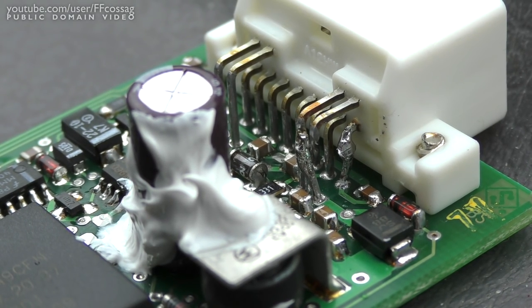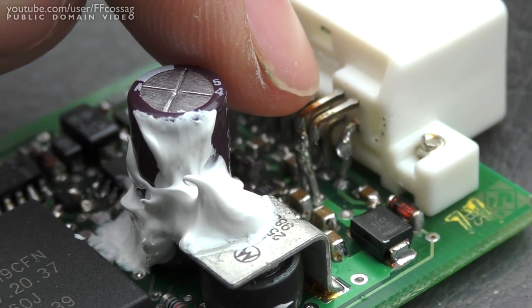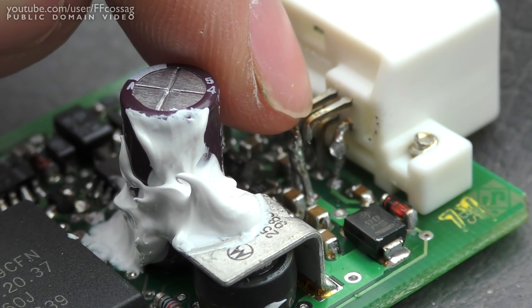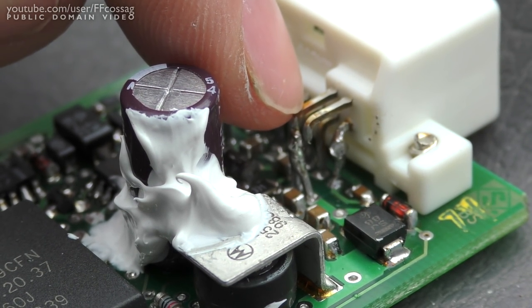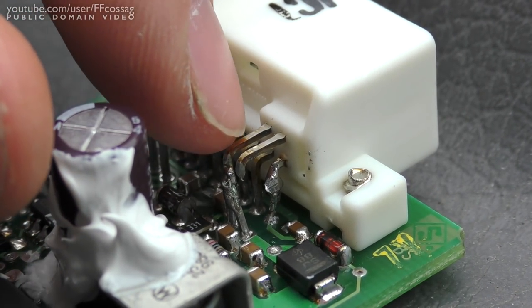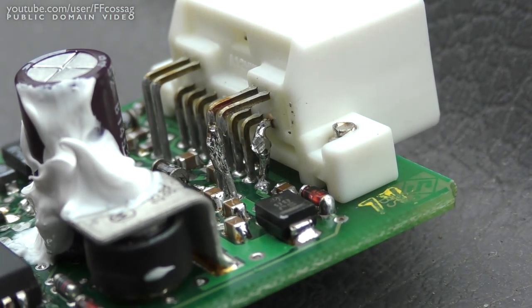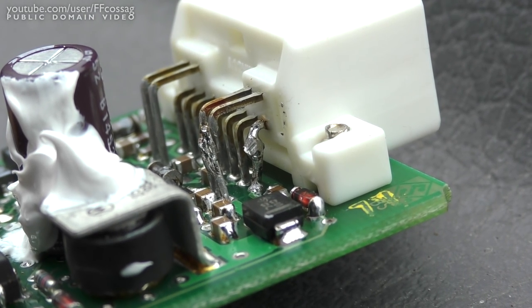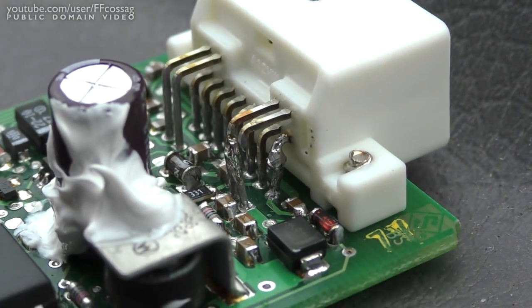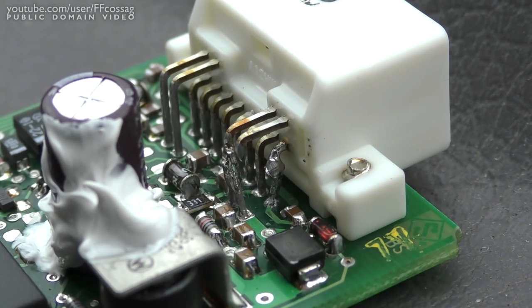There you can see my beautiful handiwork. Ignore the solder blob on that lower pin — it's these two guys. I've cut the always-on power and just leaned the pin over and solder-blobbed it to the switched power. In theory, this box should now be unpowered as soon as the ignition is off, and it should boot up and work every time when you turn the vehicle on.